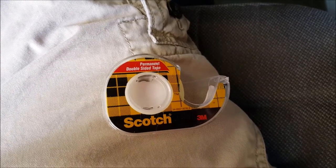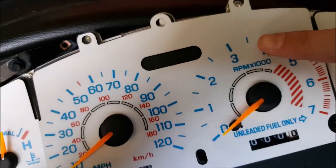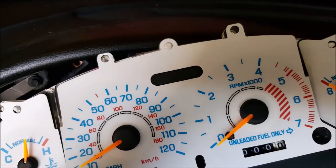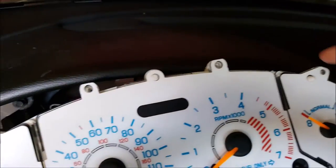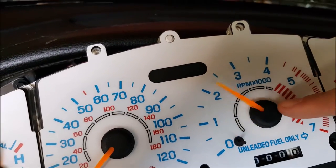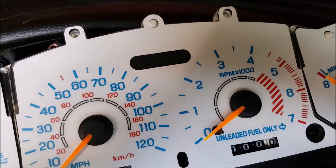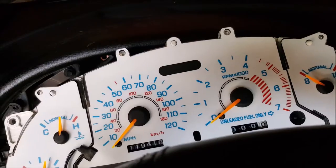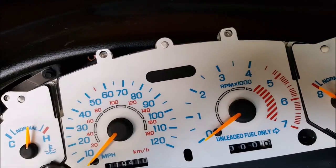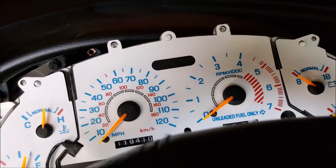To get this to work I'm going to have to use some tape so it can move freely. I'm just going to use some double stick tape — I'll peel this back and stick a little bit down there so it can press against the original dashboard and the RPMs and speedometer should be able to move freely. I've applied some double stick tape in all the corners, and you can see when I put this up it drops back down. I liked that it's holding it in place now. I also put some on both sides — I think everything will be held in place, I highly recommend doing that. That way when you put it all back together there's no gauges sticking and hopefully they all work.